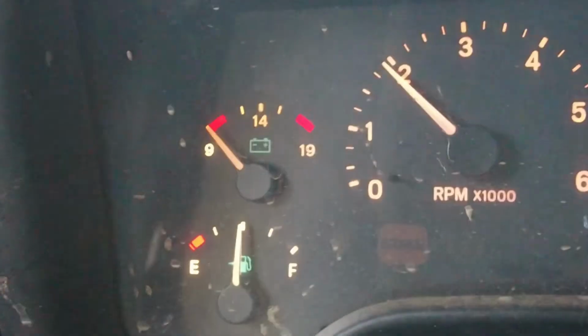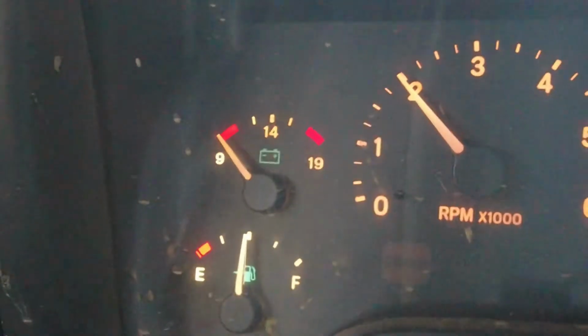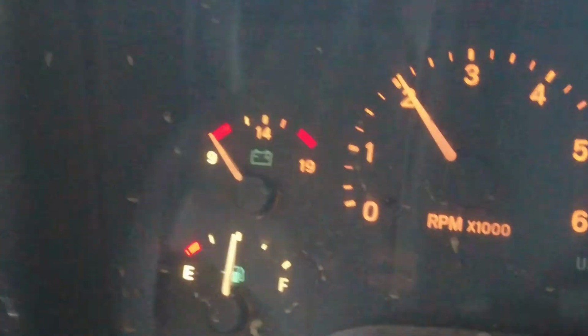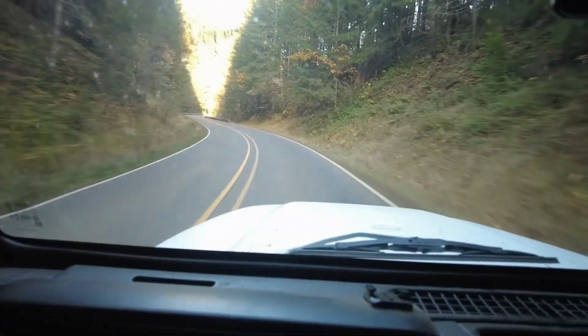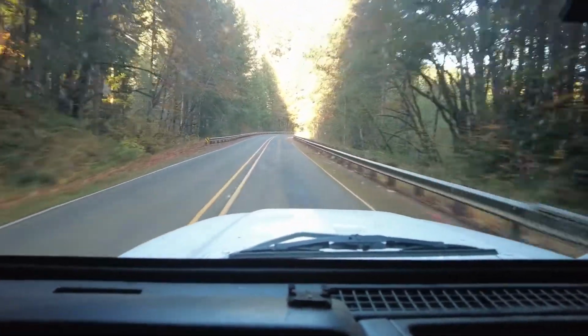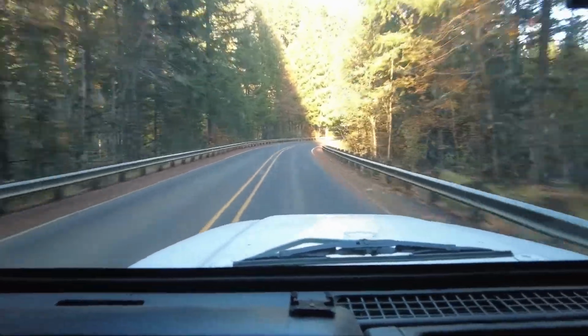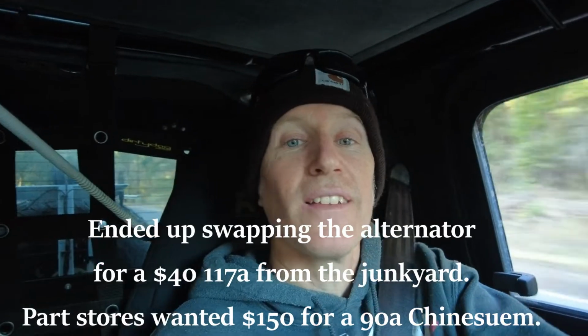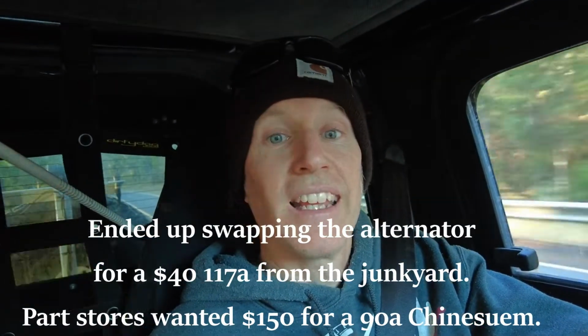Well, I have absolutely no luck on this thing. She ain't charging. It just started to squeal, and the voltage light went to zero, which basically means one dead alternator. 3 seconds away from just finishing fixing a four-month transmission debacle, and yeah. Now I get to take apart the belt drive again and change out the alternator. Can't win for trying.